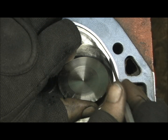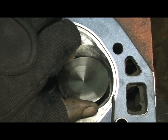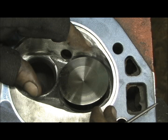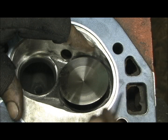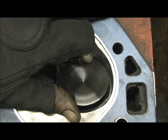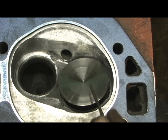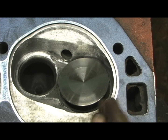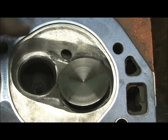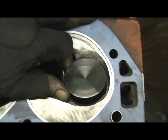And of course, don't go in here and cut that off of a 454 gasket. I have a magic little template — I put the gasket and then this filament goes in here and then I scribe the line. That line right there is almost dead nuts in line with the 396 bore so that it doesn't have an overhang and turbulent eddies start swishing around into the bore, because the name of the game here is always getting the most atomized fuel in here as we can get.